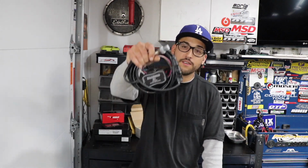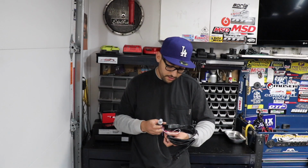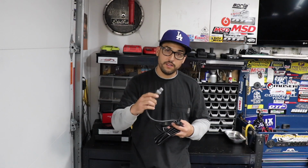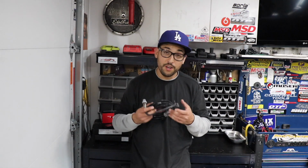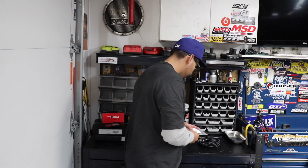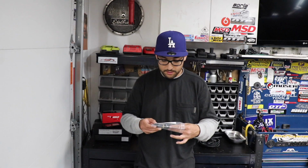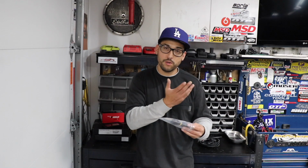So the way we're gonna make my NGauge read AFR is by installing a ZT-3. So you guys can see it here. A ZT-3 wideband air fuel ratio meter is a little gadget that basically has an O2 sensor and is gonna read how the fuel is being burnt and send it up to the NGauge. I bought this thinking that this is all you needed to hook up to the NGauge, but I was mistaken. You're actually going to have to order this little piece, this little wire. And this little wire is also by ZT-3, but they sell it to you separately. But I guess it's because you could have different gauges or whatever. So that little gadget works with different gauges.